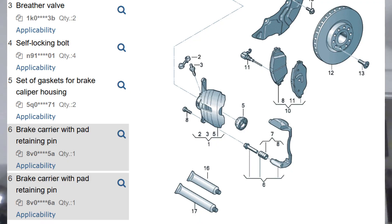The challenge is that Skoda OEM or Volkswagen OEM does not sell the slide pins for these calipers standalone. Obviously the reason for that is if a slide pin has to be changed in a caliper, it's ideally very old and the whole of the caliper carrier also gets worn out. So as a safety item, Volkswagen recommends that you change the caliper carrier and the slide pin mechanism together. However, in this scenario where my carriers are perfectly fine but the slide pins are warped — particularly because the rubber piece is messed up — I can't buy slide pins from the OEM website or even the dealer directly. They are selling me a whole carrier, which is very expensive.